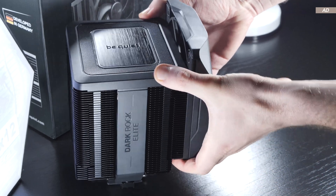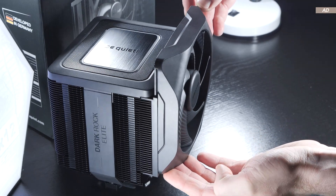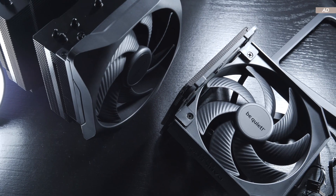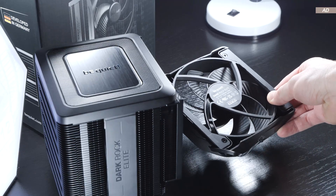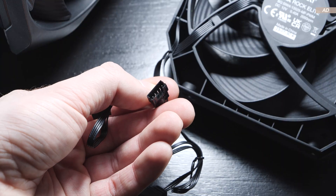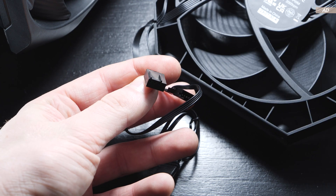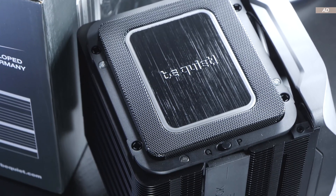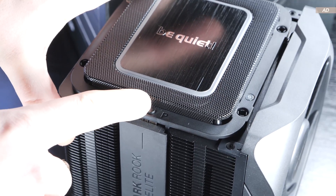The mechanism requires an excessive amount of force in my opinion, so that some users — mainly novices — will probably refrain from touching it, simply out of fear of breaking something. I also do not like the fact that both fans are non-standard and therefore quite proprietary, and might be difficult to replace with conventional fans in the event of a defect. Furthermore, the two fans are hooked up to each other using a proprietary connector, which then ends in a standard 4-pin PWM fan connector. The ability to switch between P and Q mode — basically performance and quiet mode — is great. Big praise for that.